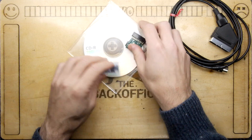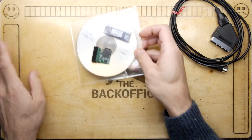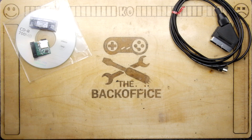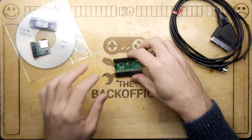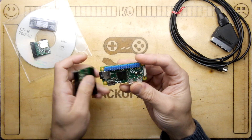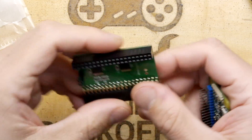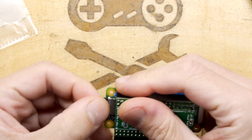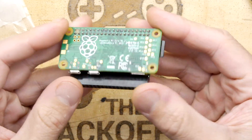There are differences though — if you've got a Model B or a Master there are definitely differences between those two. If you have a different revision or you've already got chips in those sockets you might have to play with it a little bit, but we'll come to that if we need to. And then I have this, which is the Pi Tube Direct interface for a Raspberry Pi. This is a Pi Zero and you'll see this in another video where I've actually soldered the header on — it simply pops on there and you get the software off the internet to put on the SD card. Links to the other video are down below, and you plug that into the tube interface.